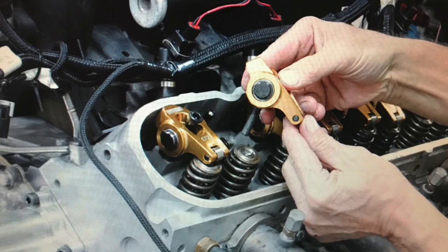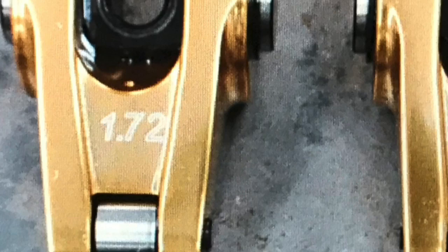This is a big dynamic equation and especially important since we're asking the factory LS rocker to do stuff it was never designed to do. It was designed to run with stock spring pressure, stock RPM range, and the stock camshaft. Now we're running factory rockers over 8,000 RPM with a lot more spring rate and a wilder cam timing. A good aftermarket roller rocker hopefully has less deflection, a lot of beef to it, so we get all the cam lift we're asking for.